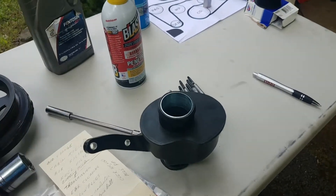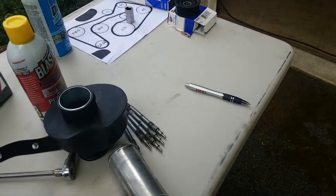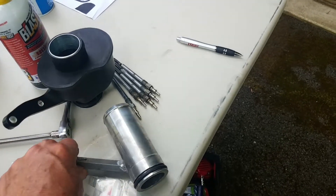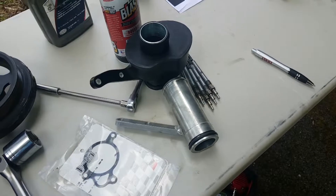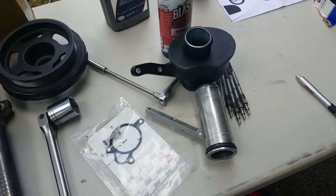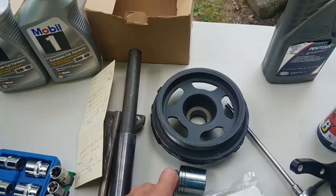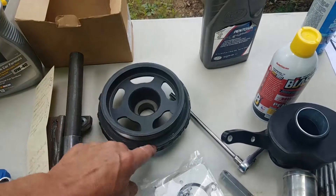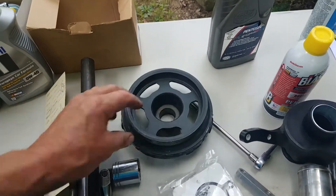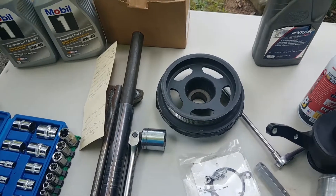I've gone through probably half a dozen of them. At one point someone recommended I buy an aftermarket aluminum tube version — it doesn't have any baffles in it like the factory one does. I put that on for a while; there was a little noise but it wasn't bad. Shortly thereafter, my harmonic balancer went. It has an outer ring fused to the inner pulley with vulcanized rubber, and the outer ring started coming off, making a horrible sound when letting off the gas at a light.